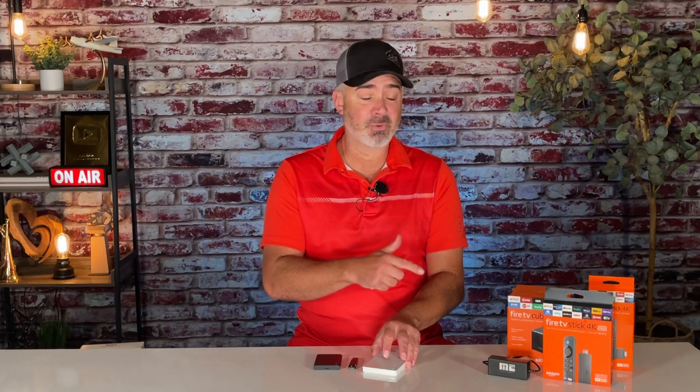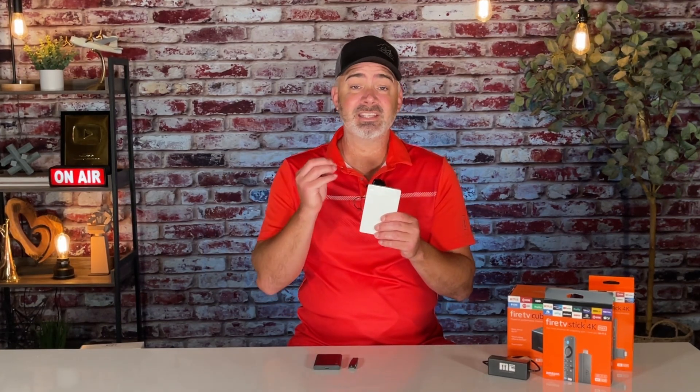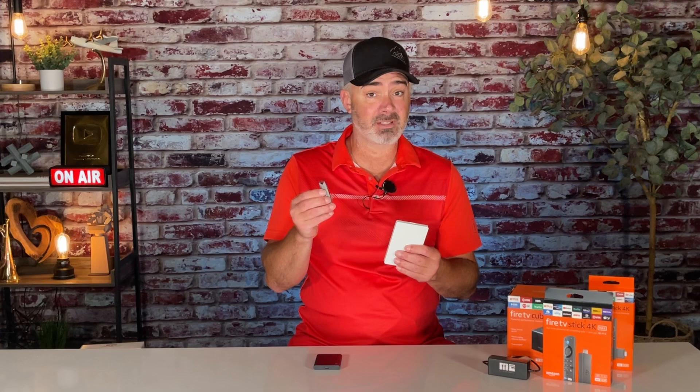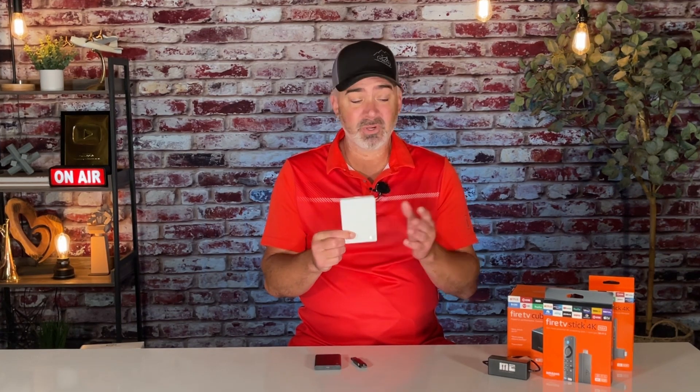I did the research — I tested probably 40 drives over about two years since the 4K Max came out and even before. I found that the Seagate Slim is the lowest-power drive among the larger options. You can use pretty much any thumb drive under 64 gigabytes, but when you go bigger you run into issues. If you want larger than 64 gigabytes, get the Seagate drive. Getting the wrong drive was one of the biggest mistakes.